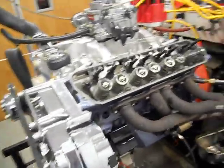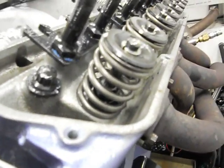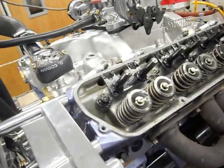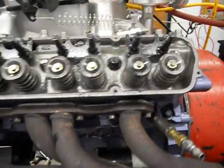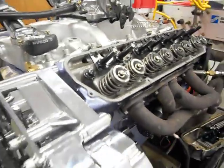What we've done now to run in that camshaft — we've only got a single valve spring on, like I assembled the head with, just to lessen the tension on the camshaft. With the double valve springs, it's just a little bit too heavy to actually run the cam in. It's much easier on the camshaft until it hardens.